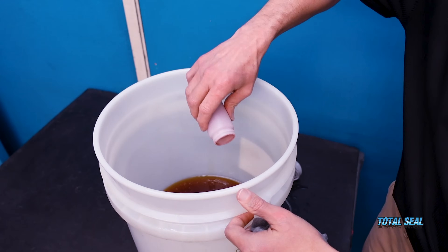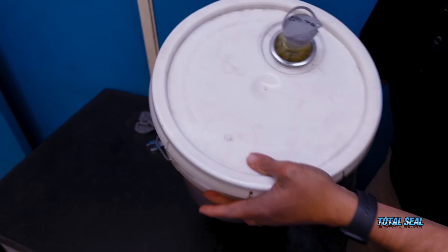It was scary seeing it again post-run. The amount of it got me, because I mixed it into the oil on purpose — a weird feeling. It really went against my soul to do that, since I work so hard to keep oil clean. But we didn't blow it up. You can actually see the damage on the face of the rings — the top ring, the barrel face — and that's one of the reasons we lost power: we started to lose some compression gases. That's why we do this stuff, so we learn and you learn. If you want to keep learning, stay tuned.